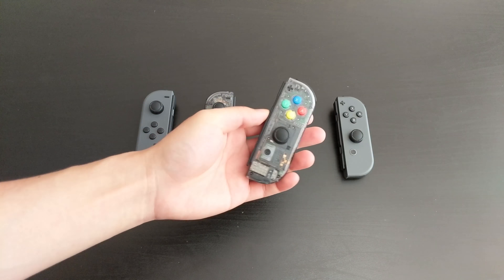Would I recommend it? Maybe. If you've got a lot of spare time and a lot of patience and determination, you can do this. I basically did this blind — there are tutorials and you can look at my tutorial as well — but it was extremely difficult. You can see here, that's one of the ribbon cables — it is maybe two or three millimetres wide. When you are pulling these things out, it is extremely hard to pick them up in the first place and to actually put them back in afterwards after you've replaced the case. So it does take some time. I didn't break anything, which was amazing, but yes, be prepared.